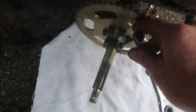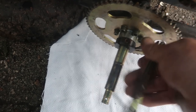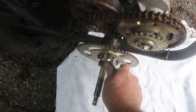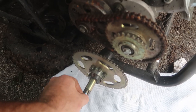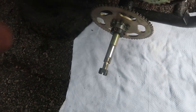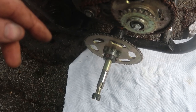The one that we chose has Allen head bolts. Tighten it down. You'll put your keyway in for your drive wheel. Put your drive wheel back on with your nut — castle nut here. And don't forget to put a new cotter pin in. Then put your chain back on, master link, your chain cover, and your drive wheel is done. It's ready to ride.